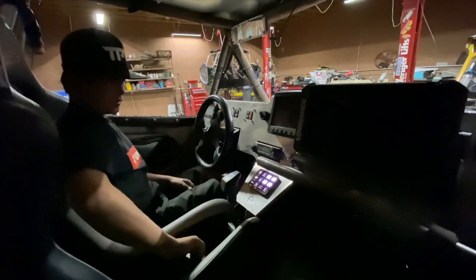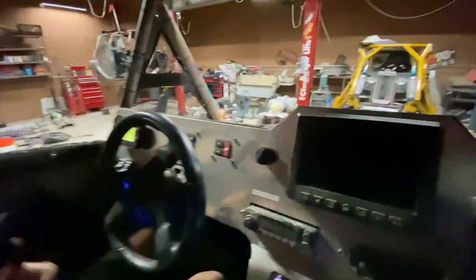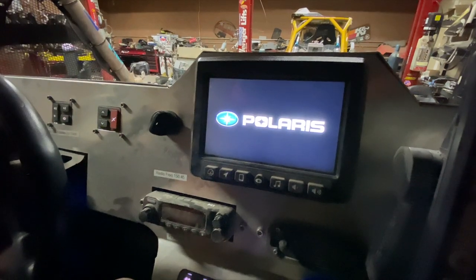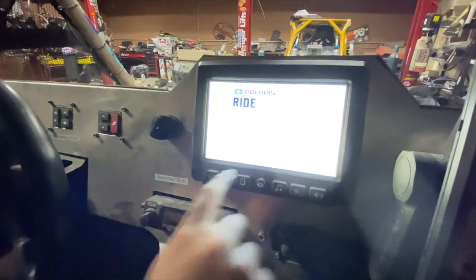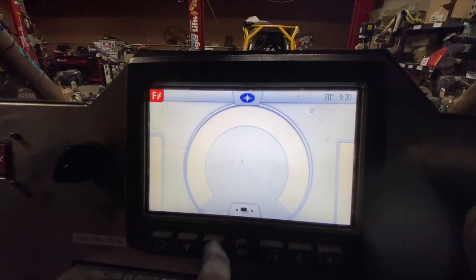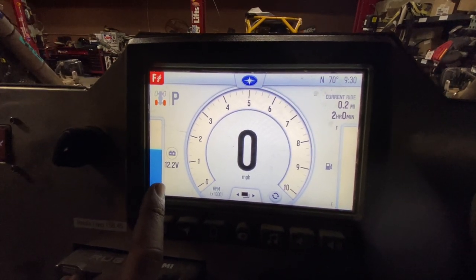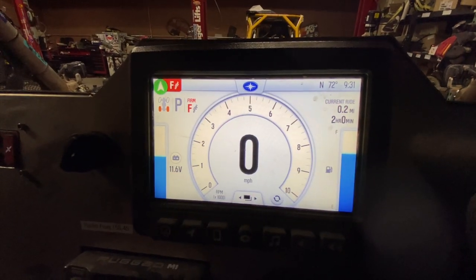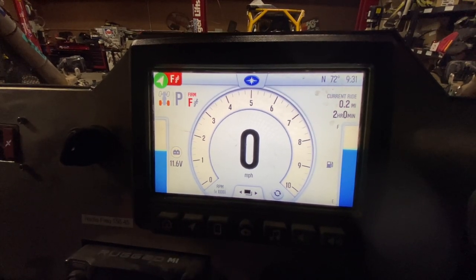Let's get started. I'll turn it on for you guys right here — when I click on this, turn on the Polaris key. We said it was losing voltage as soon as we start showing on our lights in the desert. You'll see the Polaris Ride Command pop up and then right around here you'll start seeing the voltage. There's your warning — perfect. It'll say the voltage right here, it says 12.2. So this is where we're gonna start clicking on the lights. This is the Ride Command active suspension that the Pro XP comes with, and as you can see it's already at 11.6, which isn't good at all. So I'm gonna start turning on all the lights for you guys.